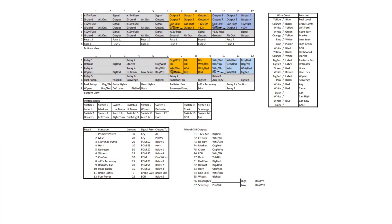I did a lot of work to figure out the best alignment of all the fuses and relays, how everything was going to be set up, and made diagrams for what wires controlled what and where they all went — between the PDM and how the PDM signals different things and how everything interacted. A lot of work laying this out.